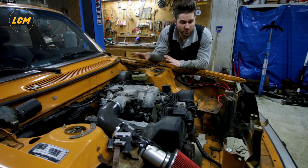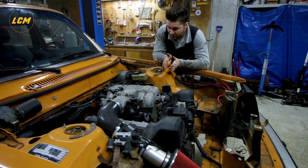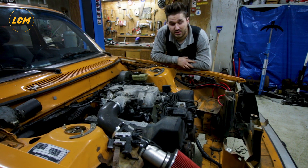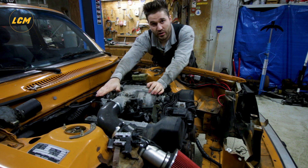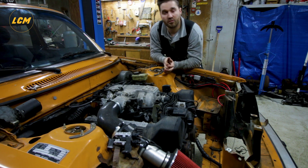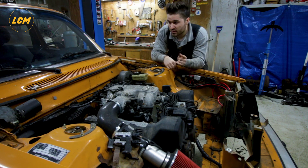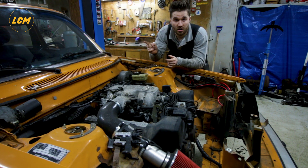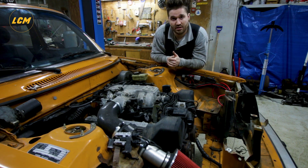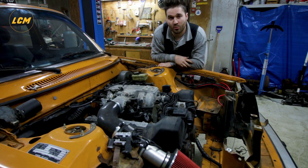For those of you not familiar with this Volvo, this is a Volvo 245 — it's a 1974 model. What we have done so far is the engine is in rock solid with the engine mounts we produced. The gearbox is also hooked up. There's a custom bracket available on my webshop for the throttle cable of a Volvo that hooks up to the 1UZ, and the engine mounts are now also available on the webshop. What still needs to be done is coolant, and I need to make the transmission hook up to the Volvo shifter. I redesigned it — I wanted it to be a cable shifter, using the original shifter with a cable instead of a rod, which will make it a lot more easy to install.